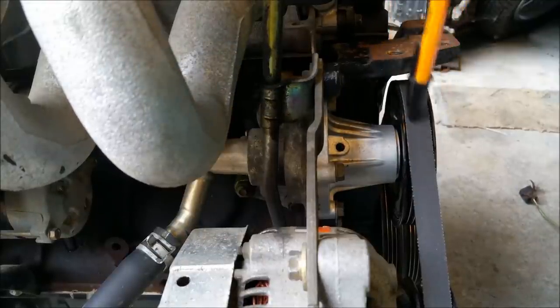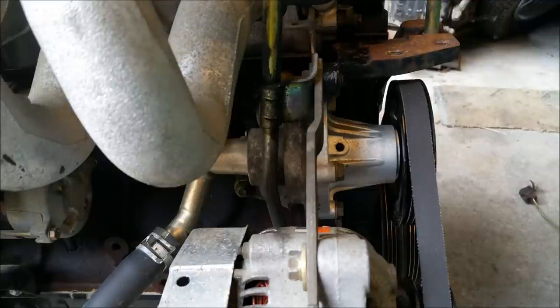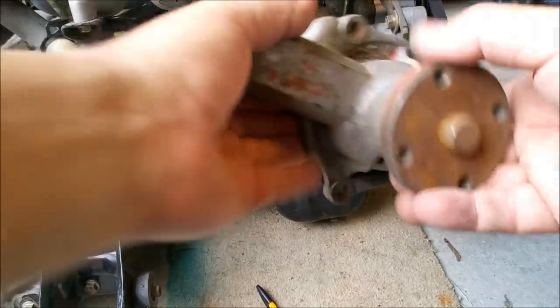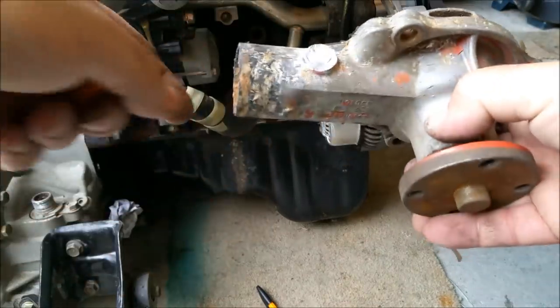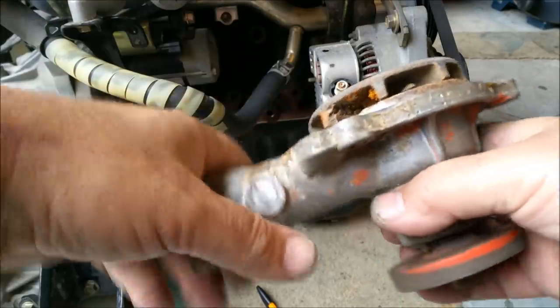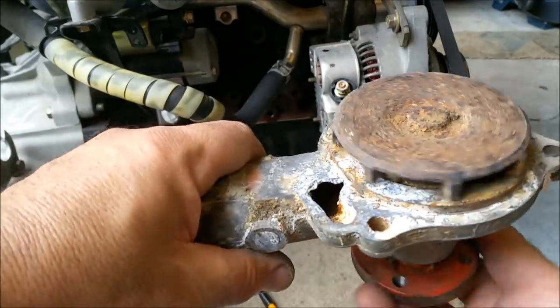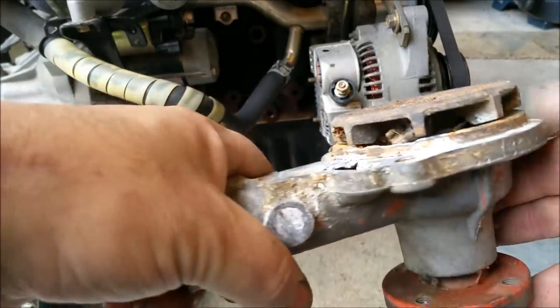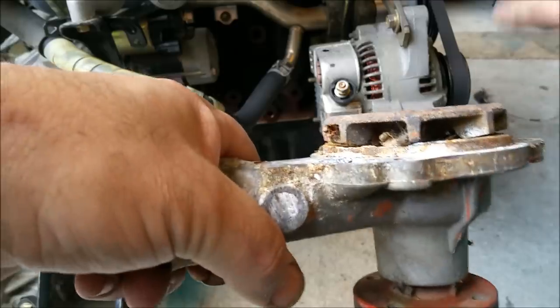The water pump is driven by a belt off the engine and circulates the coolant throughout the engine. Now, water pumps in cars are not positive displacement pumps, they're centrifugal pumps. Here's an old Holden one, and it works on the same principle. Coolant goes in here and is thrust out sideways from this impeller. From there, it's gathered in a housing and forced through the engine.